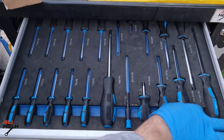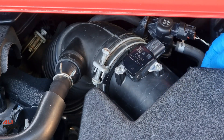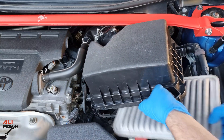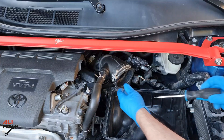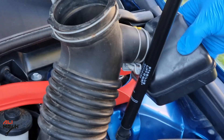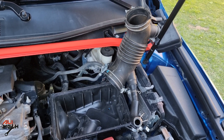We're going to start from the filter box. Take the Phillips screwdriver, loosen the clamp, and remove the mass airflow sensor wire harness. Release the two clips and remove the filter so we don't damage it — now we can pull the cover out. Next, squeeze this clamp and pull up the vacuum hose. We're going to undo the other screw that holds this hose on the throttle body. I always hold it like this, so it's out of the way of our working area and I don't have to remove the other hoses.